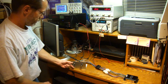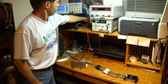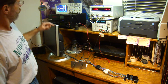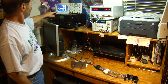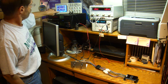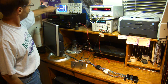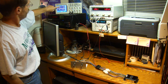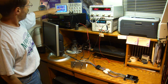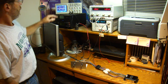Turning on my current probe — this probe measures the current going to the fuel injector. What you see here is: when the computer commands the injector to open, it grounds the input, and you can see the injector current rise quickly to the peak value of 4 amps and then drop back to the hold value of 1 amp.